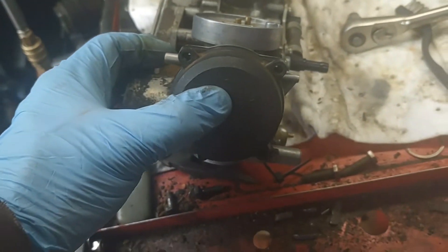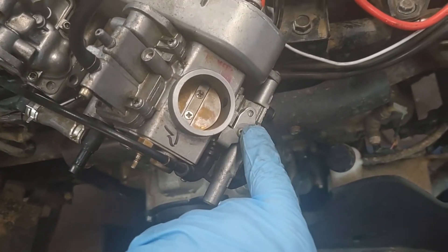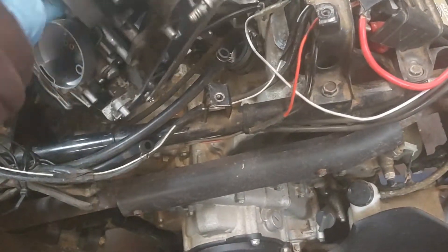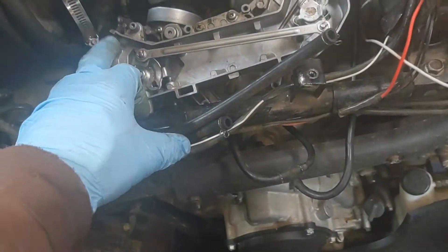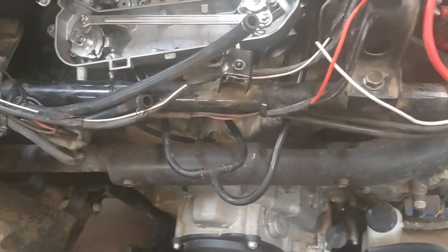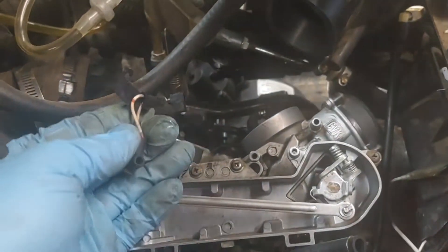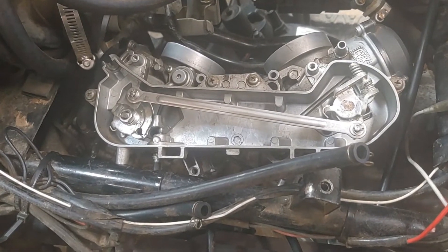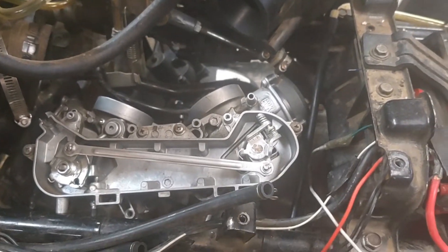Tighten those four screws up and then do the other side and stick it back on the bike. Went ahead and stuck the chokes back in with the little bracket and the Phillips head screw - front and rear. Cleaned up the end of that little choke plunger - looks pretty clean. Now flip this thing over and slide it down in here. Still want to get it kicked up to the side so you can get the throttle cable back on and the cover back on before you actually slide it fully down. Once you get that cover on, tilt it the other direction and hook the three wires back up on the right side.